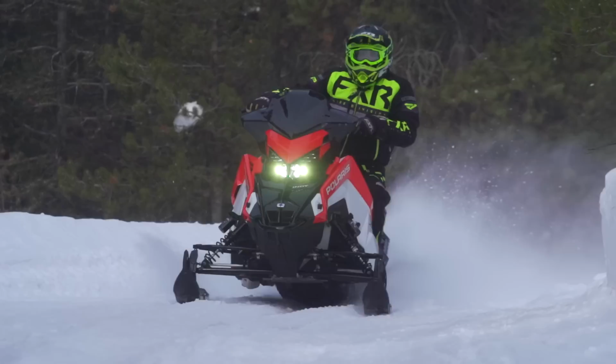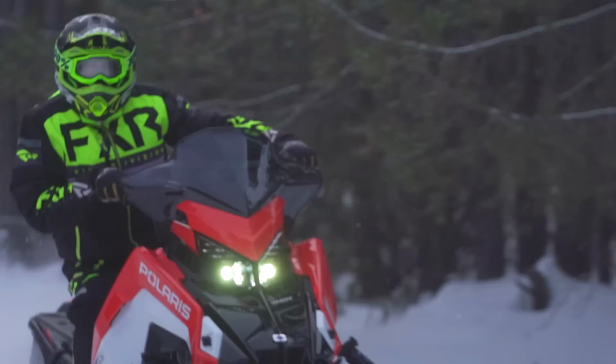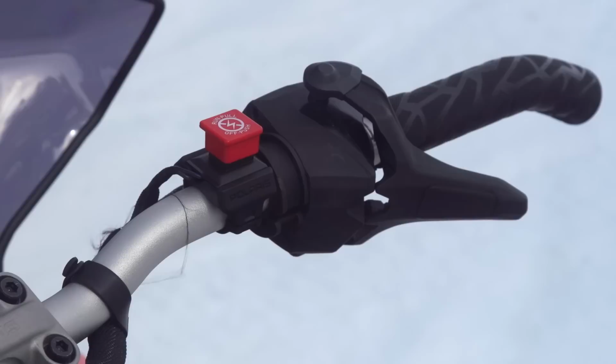We would not bet against Polaris hanging a turbocharger and intercooler under the current Matrix bodywork, which already contains a ProStar twin. The aforementioned packaging and the use of a twin-cylinder engine becomes more relevant when you realize that there's probably going to be a turbocharged version of this ProStar motor in the future, and it will fit handily underneath the current bodywork. The ProStar S4 comes with a tri-mode DBW drive-by-wire throttle actuator. We were very concerned about this before we had a chance to try it out.